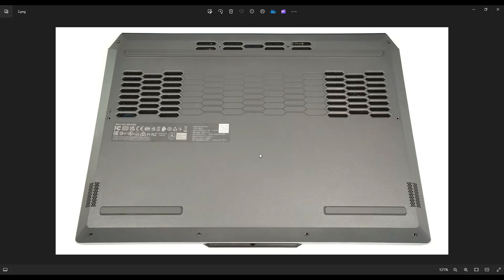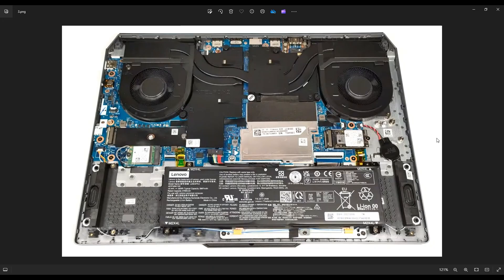After you've taken your bottom case off, this is what you're looking at for the inside of your computer. As a general computer repair side note, whenever I'm opening a computer, it's sitting on an anti-static pad. Either that or an anti-static bracelet are great ideas to avoid damaging things in your computer. If you need any help with tools or supplies for your computer project, as well as any replacement or upgrade parts for this specific model, there'll be a link above and below in the description with all those tools and replacement parts for the LOQ 15i. Now before I do anything in a computer, I will either remove or at least unplug my battery. It makes it safe to work on the computer with as little power as possible running through it.